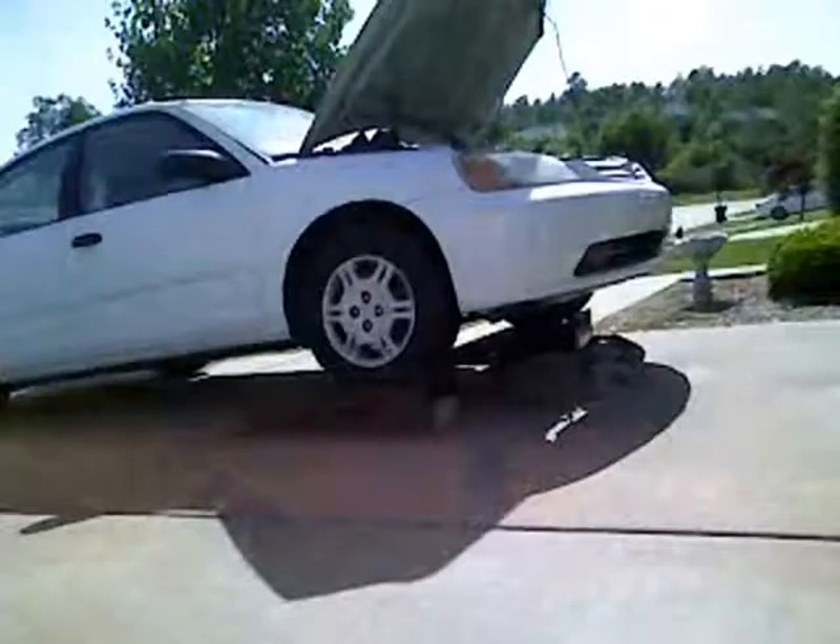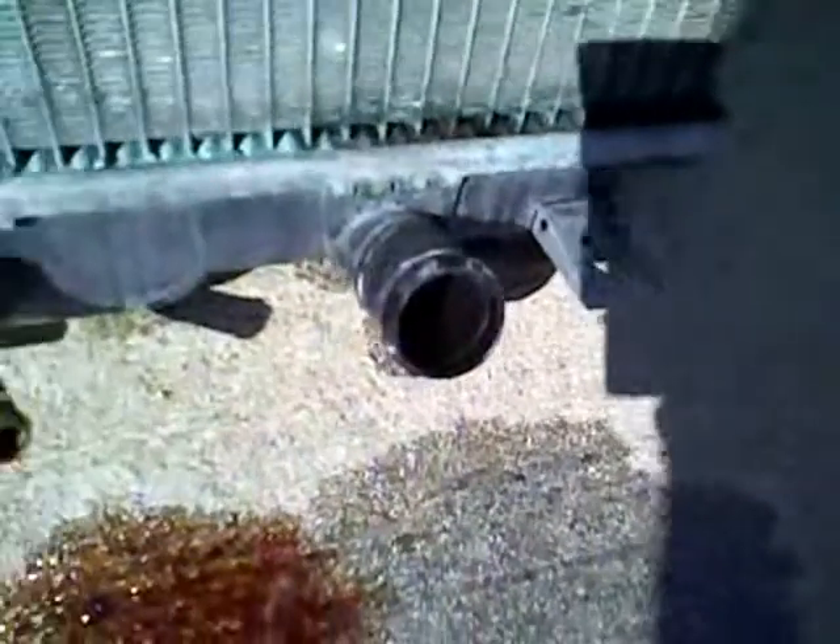Check your mounts at the bottom. The rubber mounts go into the car on the mounts on the other side. If they're cracking, you might want to change them out. These seem okay, but I'm changing them out anyway since I'm hoping this will be the last time I have to do this particular job on this car.